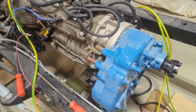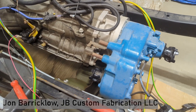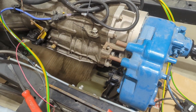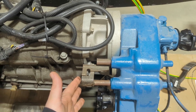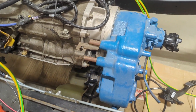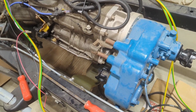So I reached out to John B. — I'll put his company up on screen. Super nice guy. I asked him what the options were and he said you can buy rails but you're going to have to take this off, take it apart, do the whole thing. So I asked if these could be modified to basically make it like a T-Style. That's what I'm going to do today. Hopefully it's going to work out; if nothing else, we'll have to pull the whole transfer case off anyway. Basically it involves cutting the flags off, drilling holes, and doing the whole thing.